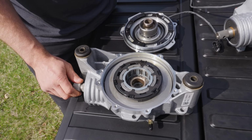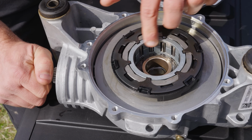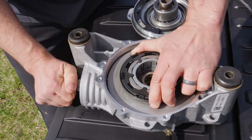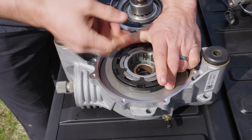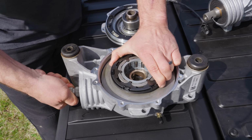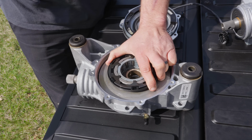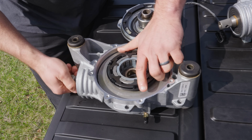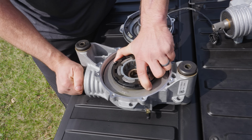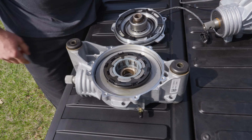When you turn that electronic circuit on and the rear wheels start to slip, basically it's going to cause a slight motion in this center cage based on the rollers and the drag on this plate. And when you get that to spin a little bit like that, what's going to happen is these pins are going to drive toward the center of this area, and you're going to actually see that as I turn this, that output hub spins in unison with the ring gear. So that's actually what's engaging the ability to carry the output power down the hub to the axle out to the front wheel. If you have an active descent control version, it basically goes the other way, and it allows it to back drive as the engine is coming down in speed versus going the normal way when you're actually powering or applying power into it.